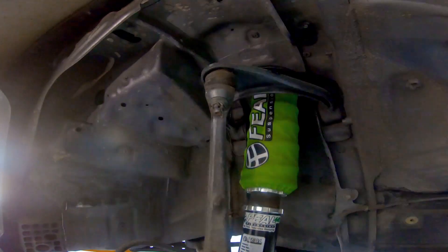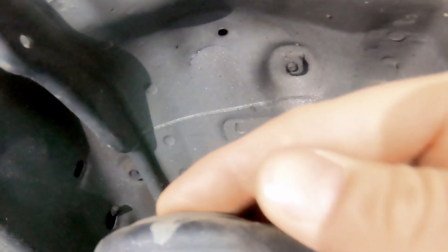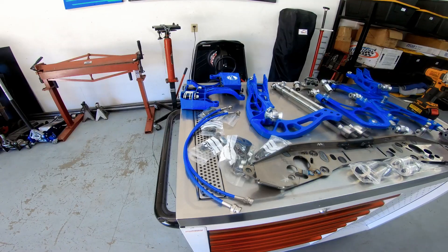We're pulling the suspension off, and here's a great view of what's happening. This part of the upper control arm where the ball joint presses in is actually smacking into the chassis itself. That's never a nice sound and it's definitely not good for the suspension to abruptly run out of travel. WiseFab luckily addresses that, and I'm stoked to see that put into the design.